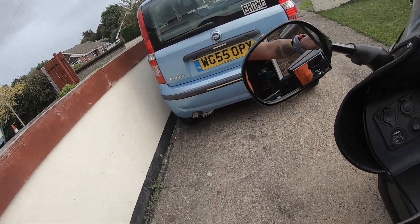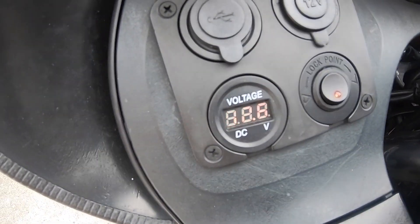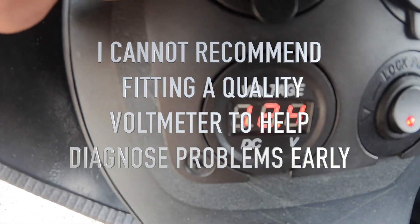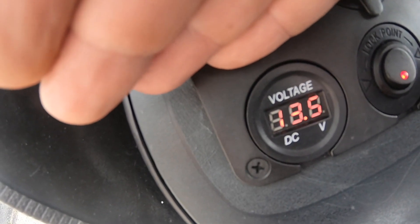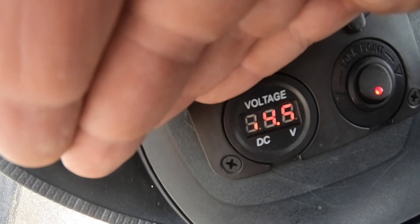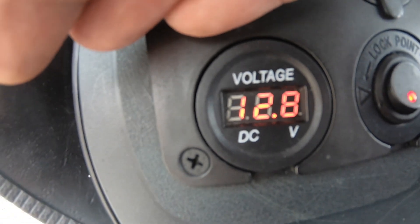If it is the original and it's been on there for 21 years, it's going to take a little bit of getting out. So I'll turn the ignition on — put you down here where the voltmeter is — that's showing 12.5 volts, 12.4 volts. Let's start her up now. She's 13... 13.5... 13.9... 14.1... 14.3... steady at about 14.5, 14.6. And as I reduce the revs, she's come down to 12.8 volts.